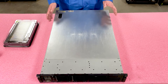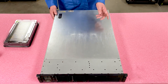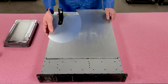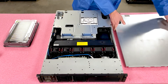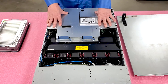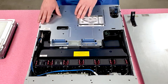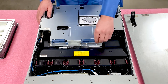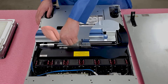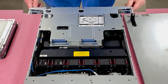It's a little bit more difficult than some of the other machines — the G7 is much easier to get into. First things first, you need to always make sure that the latch is set to unlock. Simply pop it open and voila, you are in. Now there is a riser on top that covers everything and will prevent you from being able to remove the air baffle, so you're going to have to knock out a couple of screws — two up front and three in the back.